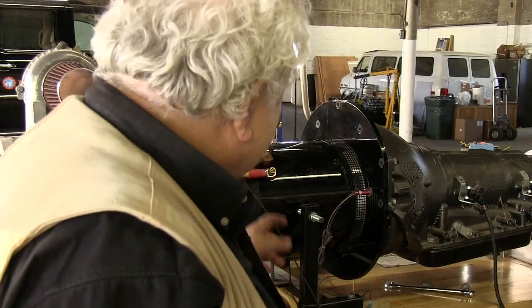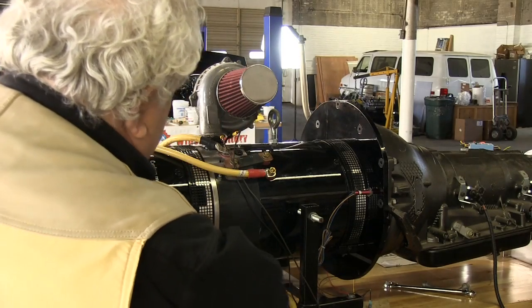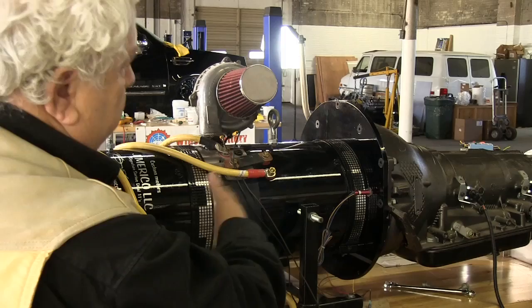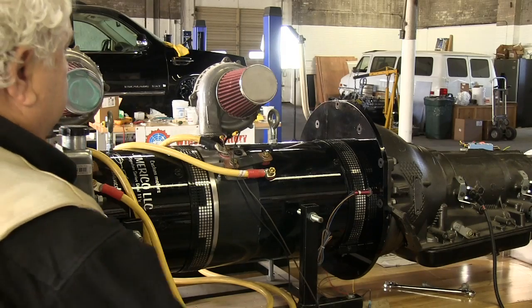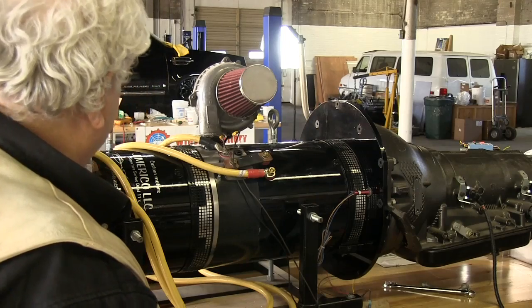Here we are on the back side of the motor. Here's our motor, and these are our connections. You can see we've got 2 full sets. This is really 2 motors that have simply been joined on one shaft, and we are going to drive the motors separately with 2 different controllers.